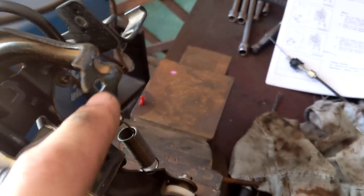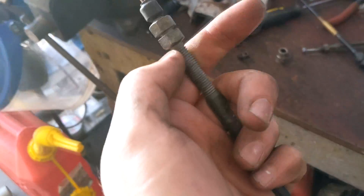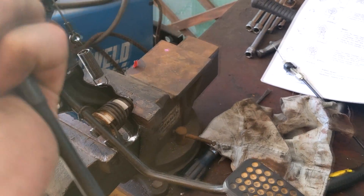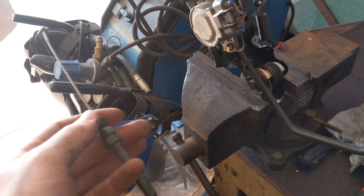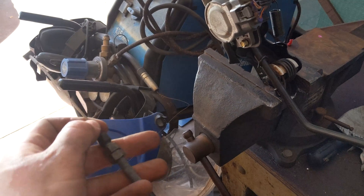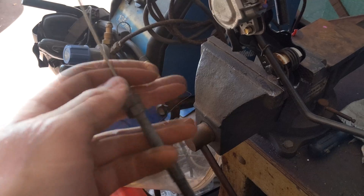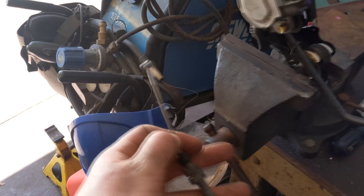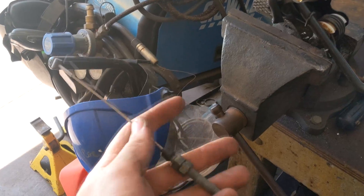I'm just going to file this out somewhat - I've already started it - just so that this cable end will fit in, and then I can lock it off. This cable is going to be a bit too long, so first I'm just going to run it into the car through a grommet, and I'm going to hold it and go for a drive, set the speed I want on the cruise control, take my foot off the pedal, and what this should do is pull in because it's trying to adjust the speed. Once I know this works, then I'm going to hook it up.